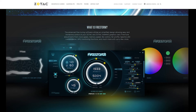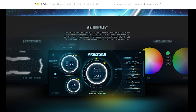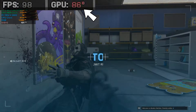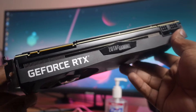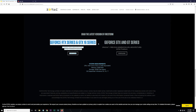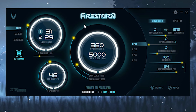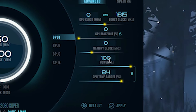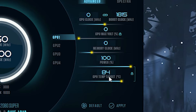What I'll be using is the Zotac Firestorm app that controls my 2080 Super, limiting the GPU temp target to a comfortable range. These cards come with what they call Ice Storm 2.0 technology that allows them to stay pretty quiet under load at temps up to 89°C with no throttling. But for my own sanity, I don't want my expensive GPU constantly chilling in the fire zone. If you have a Zotac card and ever wanted to know how to change the RGB, the Firestorm app is good for that as well — download link below. Once open, you'll see similar controls to Afterburner. You can even set custom fan curves here. What I'm focused on is the right side where you see the power percentage and GPU temp target sliders. These two sliders are locked together, but you can unlock them. Once we adjust the GPU temp target, it will automatically adjust the power slider accordingly. I set mine at 81°C temp target, which limits the power to 92%.